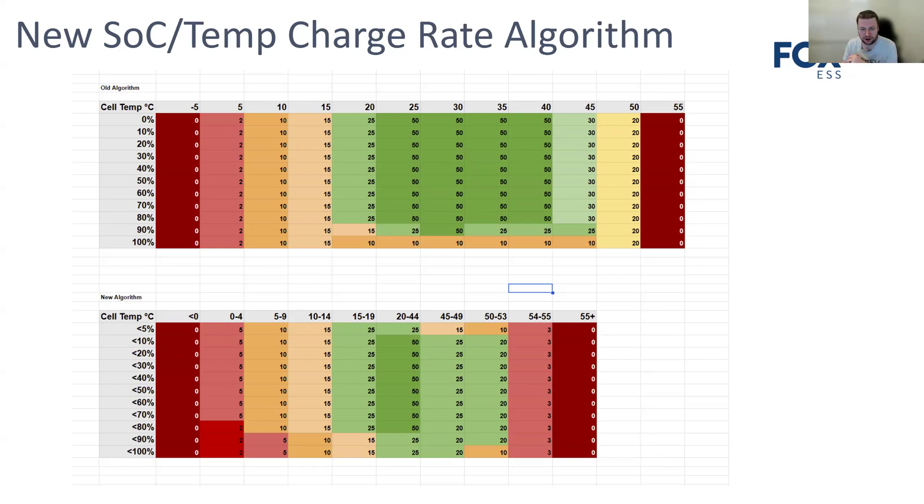What they're doing is standardizing it to a slightly more conservative and reasonable level. The obvious disadvantage is that charging takes longer when the battery is colder. There are multiple discussions about how best to combat a cold battery through installation location, insulation, or just accepting that for a few cold weeks a year you'll see a slower charge curve. When it's really cold the battery can effectively go into suspension and won't charge or discharge — that has caught a few people out and generated threads on the forum and Facebook group.